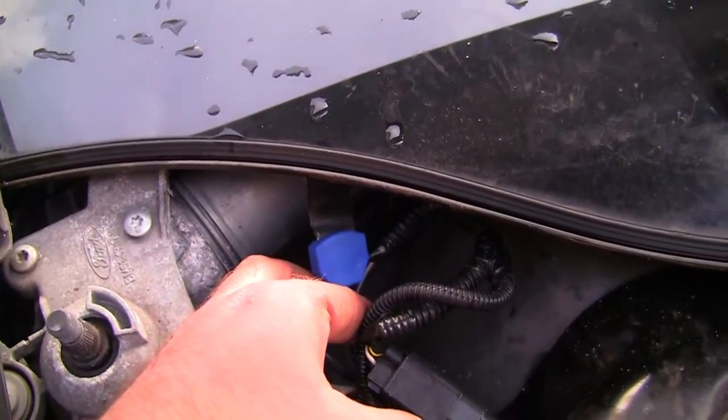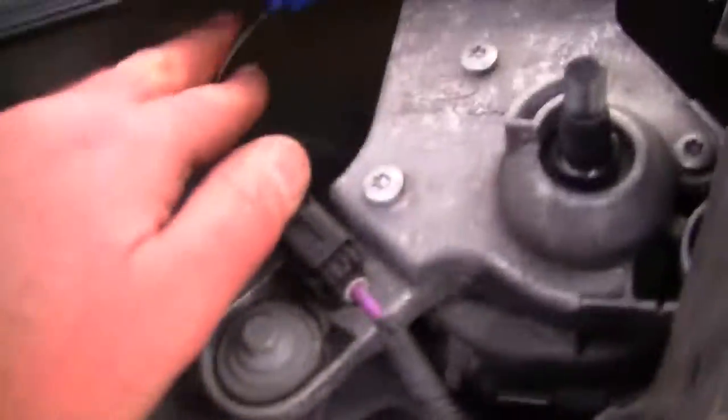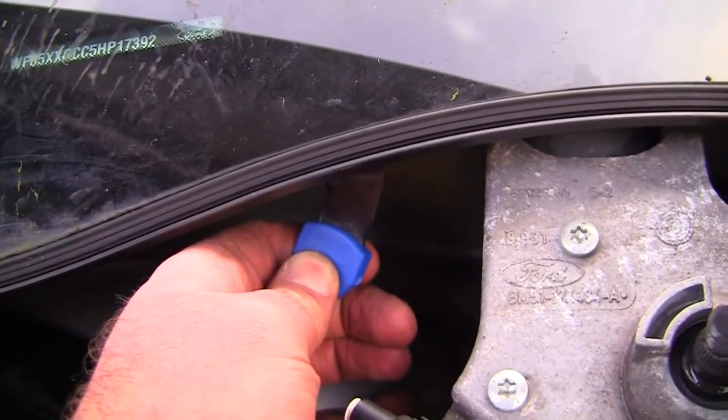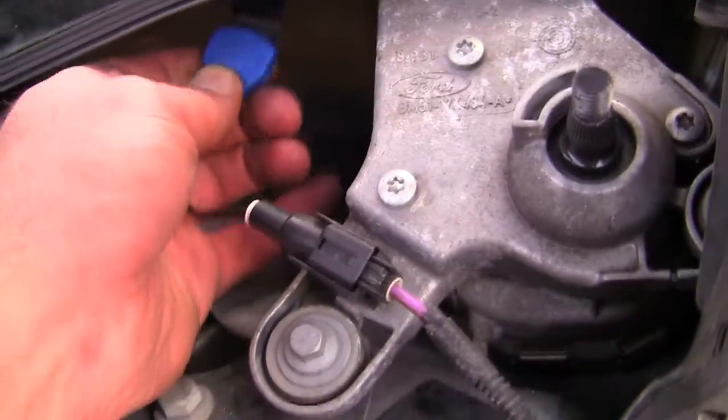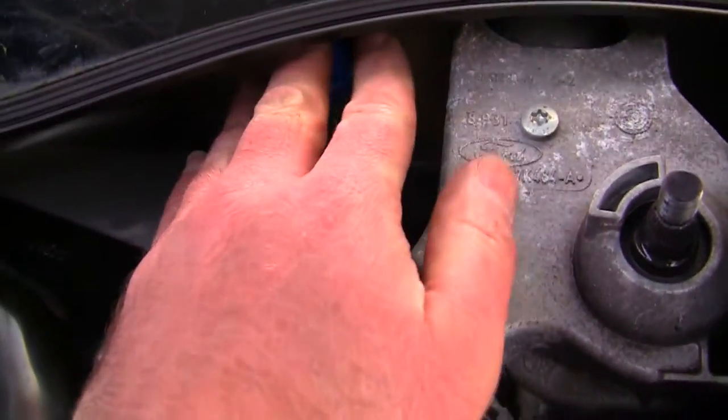because I know a lot of people have subscribed to the channel looking at the heated front screen. These are the ribbons that connect to the actual windscreen that make the heated windscreen work. So if you've got one that's not working, there's a couple of fuses in here, but these are the ribbons, and nobody ever films this. But I just want to show you on the later models, like a 17 plate Focus, these are quite well out of the way. On the earlier models, apparently when the wiper arm was moved, they could get touched and broken. Anyway, two fuses in there, one for each side of the screen.